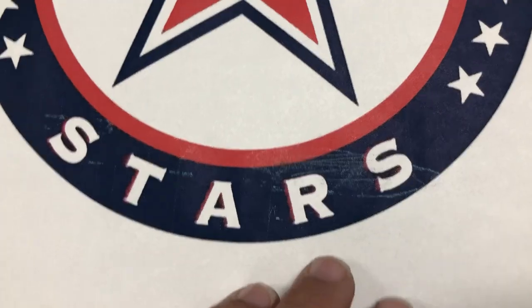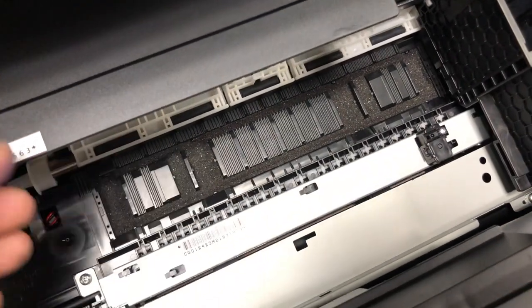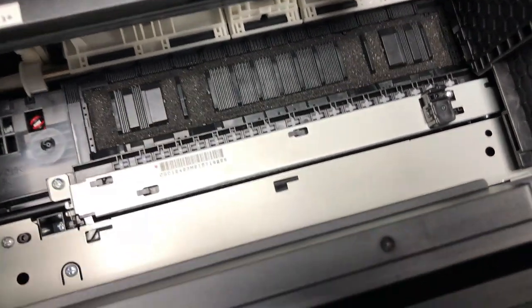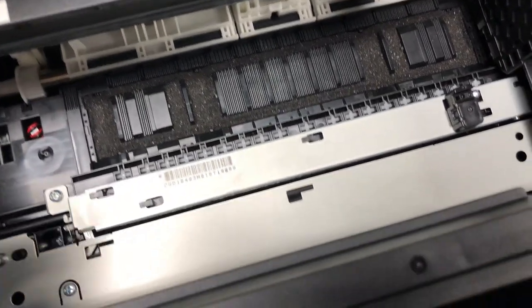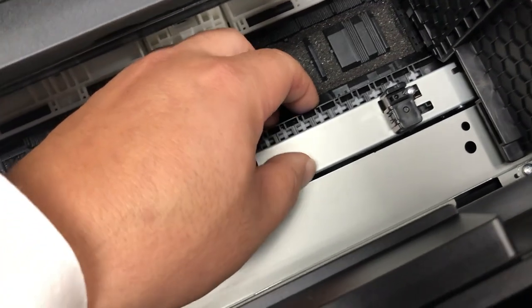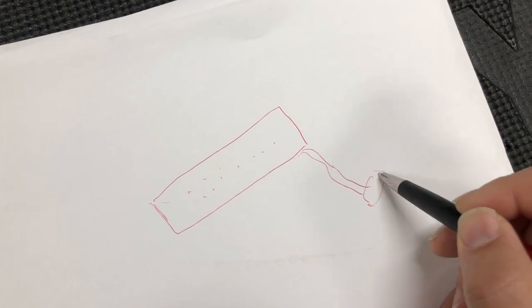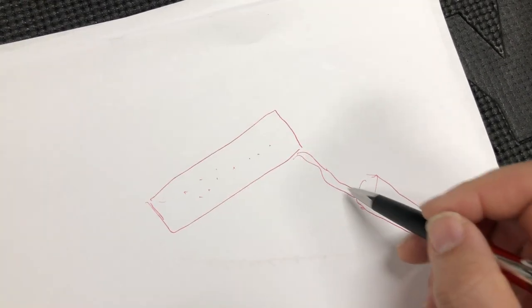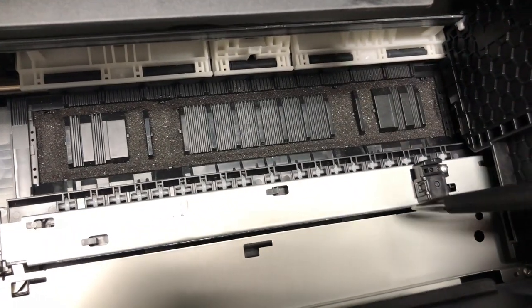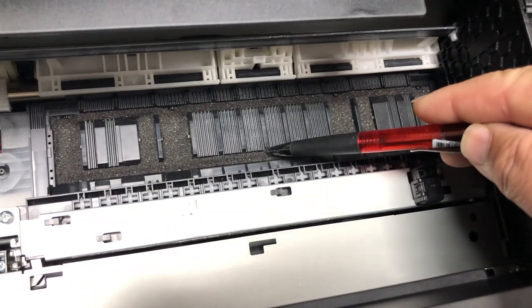Remember, we were getting scratch marks even at matte zero. In the next video, if I have time, we're going to take the wheel off — and it's not as simple as it sounds. First, the wheel's function is to press the paper down, so you need something else to keep the paper flat. Second, there's a paper sensor built into the wheel, so you need to handle that. In a nutshell, we'll have a platform underneath the paper with little holes to suck air in, connected to a regular household vacuum. You take the hose out, connect to an adapter, and the paper gets sucked down onto the platform and stays flat — pressed down by air pressure rather than the pizza wheel.